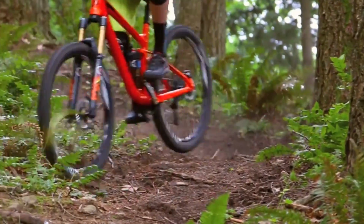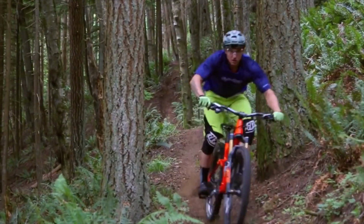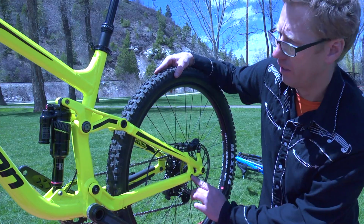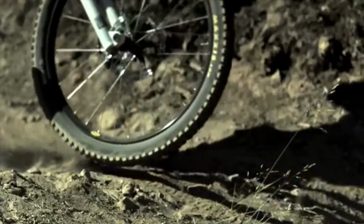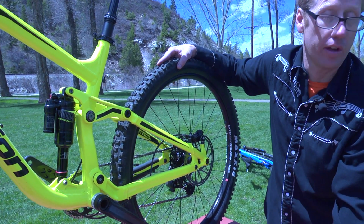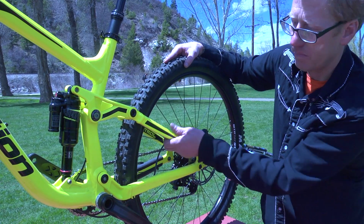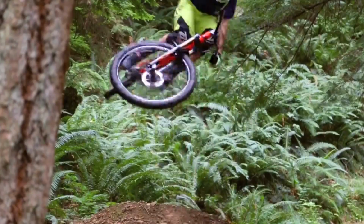But really, it's personally my favorite suspension design for pure bump compliance. We've got 4 pivot points here, here, here, and here. So the whole suspension can float, as it were. And now it had the reputation of being slightly flexy because of all of those pivot points. Modern bikes, good sealed bearings, big sturdy tubes. Much of that flexible nature has been rectified over time.